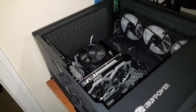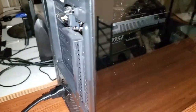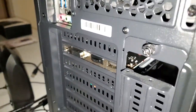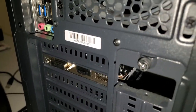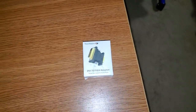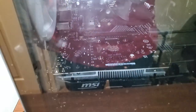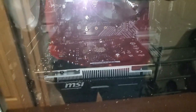I'm going to be sure to connect all the cables back on and we're going to test it out. Let's take a look on the inside with the flash — big difference. Oh, there's the DisplayPort, the DVI port, and the HDMI port. I'm going to be using the DVI to VGA adapter for my monitor. And a huge difference — the GT 710 is no longer there, and the GTX 1650 is successfully plugged in and screwed in.